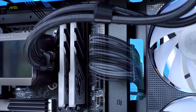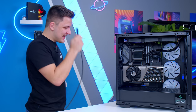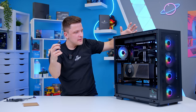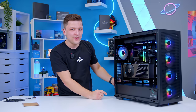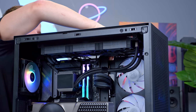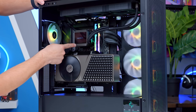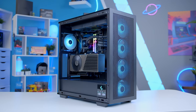CPU to the top left, motherboard to the right-hand side, and then any fan and front panel cables afterwards. I haven't wired up the JFP1 cables yet, so let me boot this manually with a screwdriver. It's on — we've got power. Fans at the front and back are on and spinning, and the RGB's looking good. All I was missing was one fan connector for the 120mm fans on the radiator at the top, and a fan and SATA power cable for the RGB pre-installed 140s on the side. The screen's turned on too, which is amazing — we can configure that in software later.